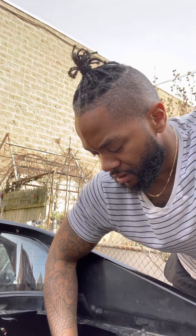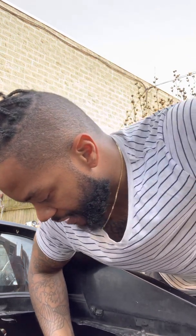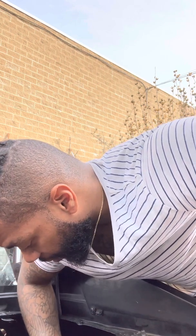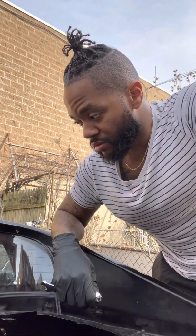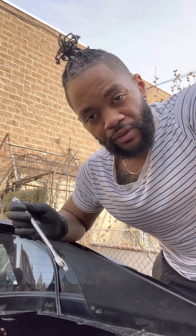I sent some axle stubs off to Drive Shaft Shop so they could see about possibly making us some stubs, because they offer level 5 axles for us now, but they do not offer stubs. For those of you that know, the axles in this car are set up like a Porsche design from the factory. The only thing is that we have weak cages. They never offered stubs. They offer outer stubs, big boy outer stub splines, shafts, and the inner cages and races, but they never offered actual stubs.